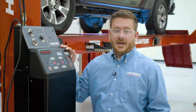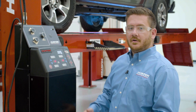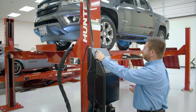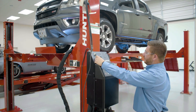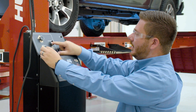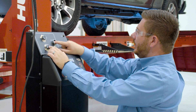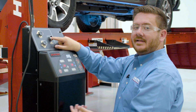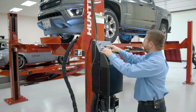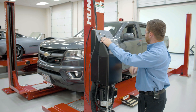Now that we've lowered the vehicle back off the swing air jack, we're going to bring the vehicle back down to the floor. Just like with the swing air jack, we want to take the lift up off the locks, disengage our locks, and bring the vehicle back down to the floor. So first we'll raise the vehicle slightly. Once we've raised the vehicle a little bit, we press and hold our lock release button — you hear a small puff of air as those locks disengage. Then while holding the lock release button, we simultaneously hold our lower button. It's good practice to give an audible clear signal to let anyone around the rack know the vehicle is coming back down. When lowering the vehicle, it's important to watch the lift and the area around it to ensure no one enters the area as the vehicle is descending.